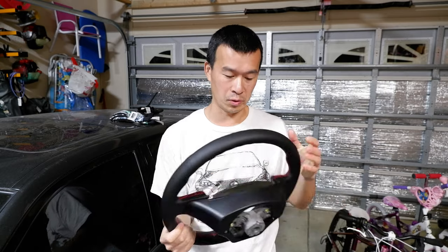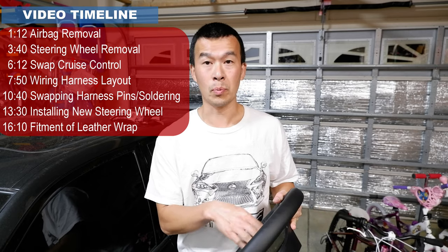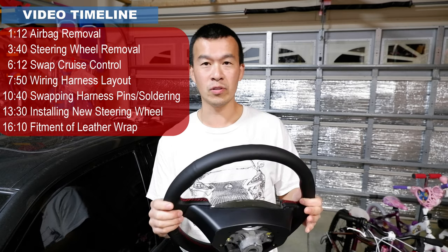It's a pretty easy install. I think there's only like two little screws that keep the airbag on. The airbag comes off and it's just that one center screw. You just have to make sure that you line it up correctly. The teeth are pretty fine on here so you can easily misalign it and have your steering wheel off to the left or right a little bit. So today we'll go ahead and install that and go through it in detail.